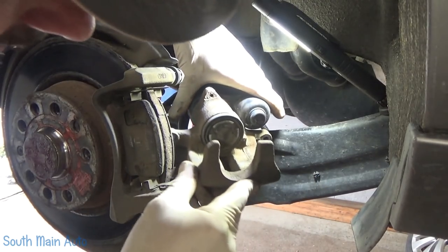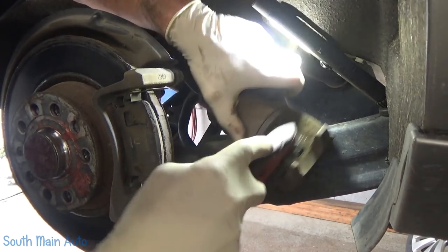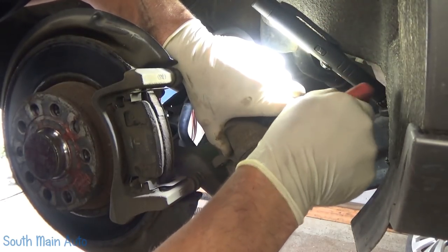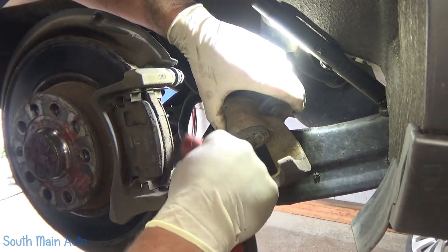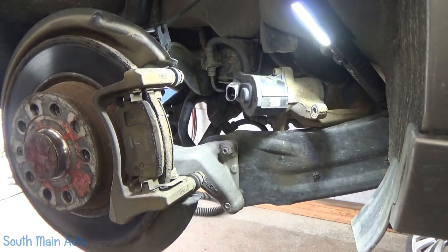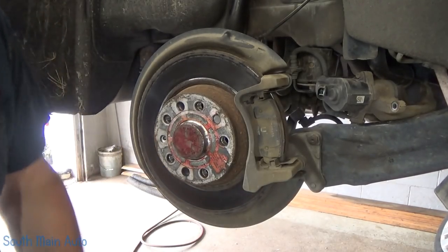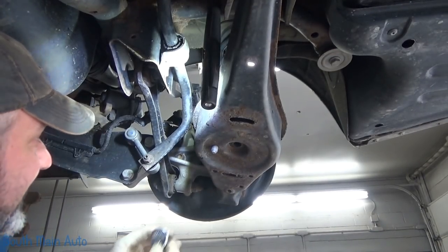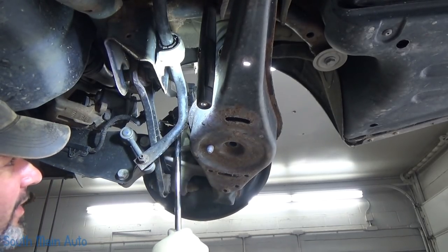Let's push them back and get a little wire brush to clean off some of the crud here. Good thing we read. Those ears are in really nice shape actually — no rust on them. We're gonna set that up where it shouldn't fall too far. Zipped a little bolt out of there — probably triple squares holding that little fella on. And it is — I've got an M14. There's a speed sensor up there that's pretty close to it, so don't let your wrench slip.